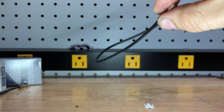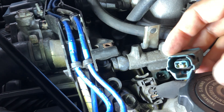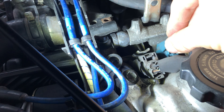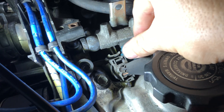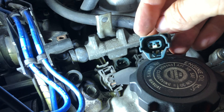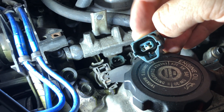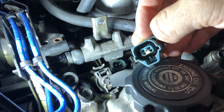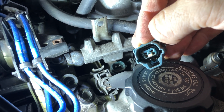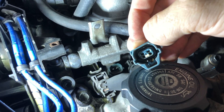Do it to the other side - pretty easy. Now the trick is we've got to do that to the one on the car. Back on the car, we're going to orientate this - this is the bottom, so our little clip goes on the bottom of the injector. Remember that when putting everything back together. The good news about this one is it's garbage so it's going to break and crack as we depin it. You can be a little rougher with it.